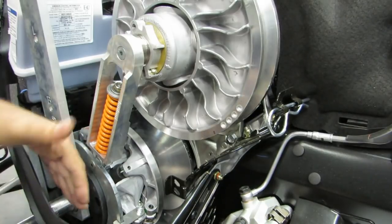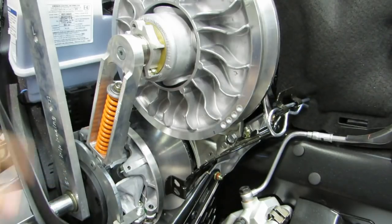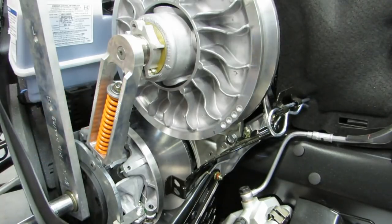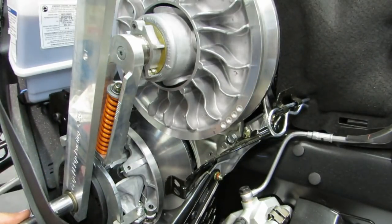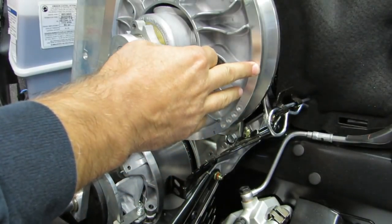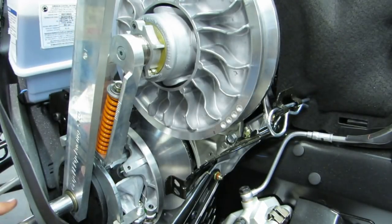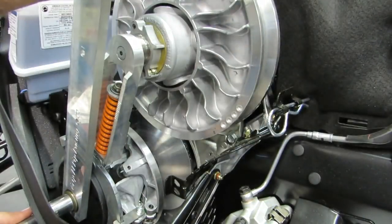The outside of this P-drive clutch has a machined surface. If you put a dial indicator on that surface and turn the motor over, there's no runout. So the end of this plate is square to the engine — that's why we put our alignment bar on that plate. When you rotate it, we're going to take a measurement at the top of the clutch (12 o'clock position), the bottom (6 o'clock), the 3 o'clock or right side, and the 9 o'clock or left side. By hand, you loosen the clutch bolt and rotate this bar, then lock it in place at the different spots to take measurements.